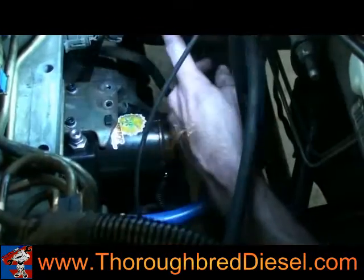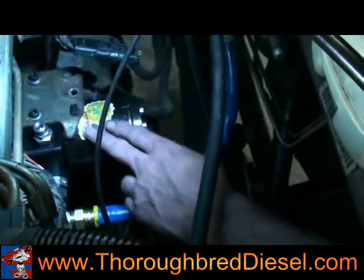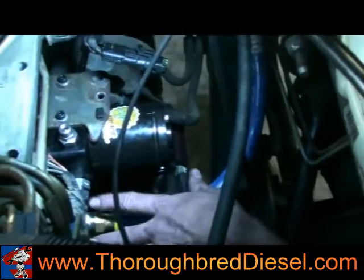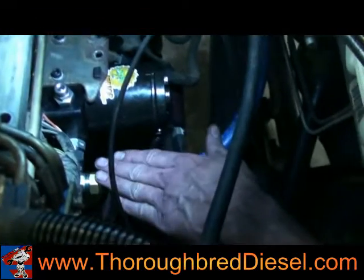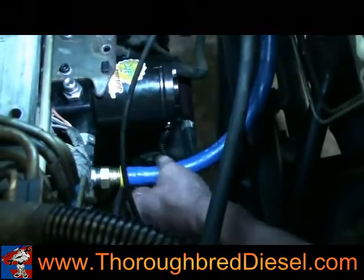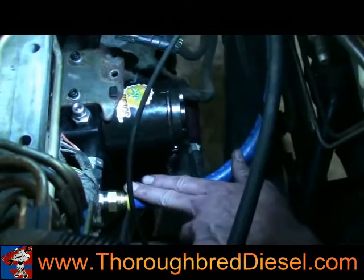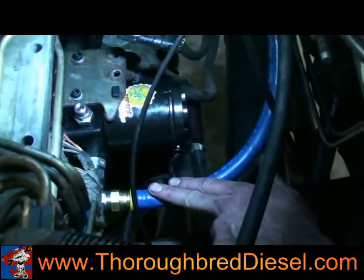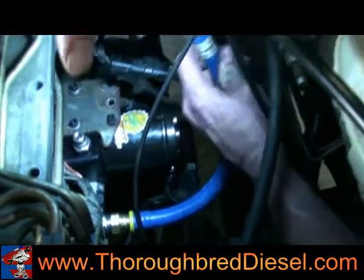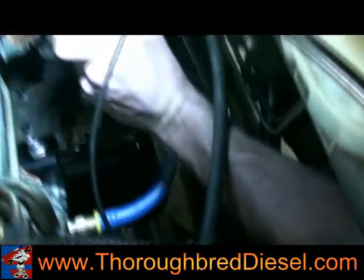We've got our Raptor pump installed here. Okay, the 2 mounting bolts are Allen heads. They're 3/16. A little while ago we told you to have your fuel fitting pushing up. Now that we've got this installed and learned a little bit more about it, really the best way to do this is point your outward line up towards the top of the pump. Keep the length of the hose, because we're going to have to turn back around and come back to the fuel bowl like this.